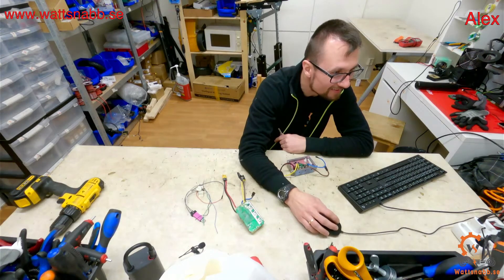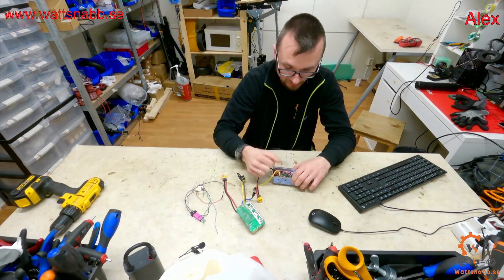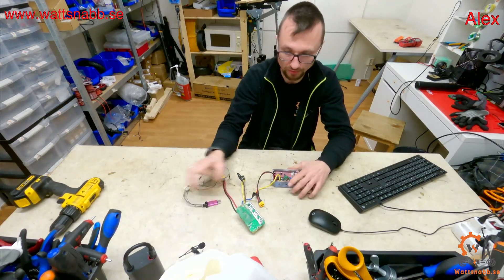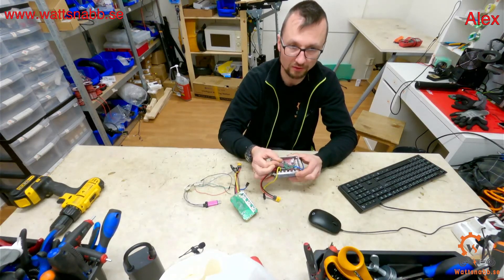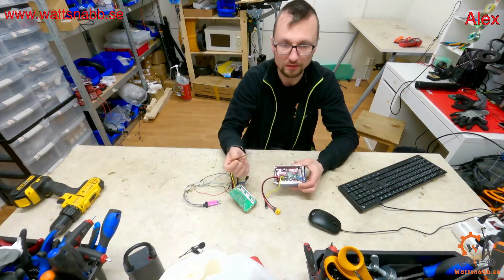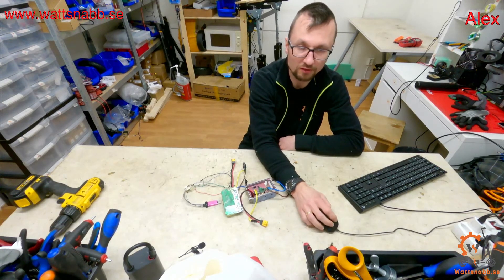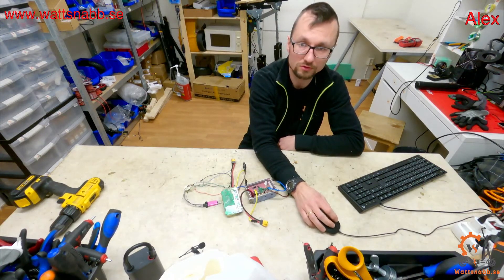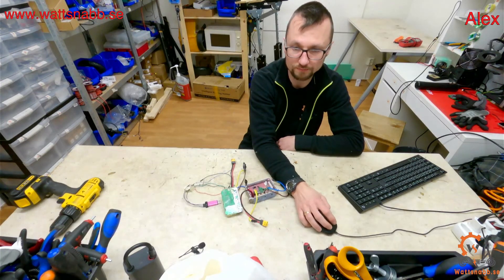Nice to hear that I helped you before. Just so you know, if you accidentally upgrade to the firmware, here's the solution — you have to ST-link it. There are a lot of videos on YouTube about it. I have a video on how to do it on the G30D controller with three capacitors. The process is the same for the regular controller but the connections are on the upside instead of the downside. Hope this will help you, and if you have any questions you can email us or contact us by Facebook. Thank you very much, don't forget to subscribe, like the video, spread the information, and I will try to share this on different Facebook pages. Thank you, bye.